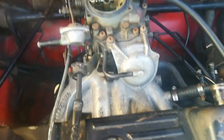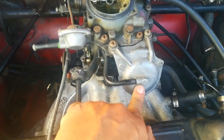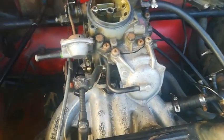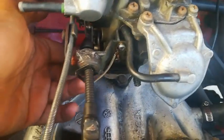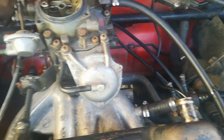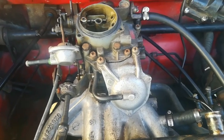So there you go — you have an idea as to what the second stage is, and if yours is in fact in need of repair or replacement. As I said, it's just this unit that comes off here, and there's a diaphragm in here — not sure if these are sold separately at a spare shop, but the diaphragm can be repaired. Also remember your second stage can be affected by a leak in your carb base plate, your servo pipe, and also your brake booster. Ensure that all those things are always 100%, because all these things affect performance on the Golf Mark 1. Thanks a lot for watching guys.